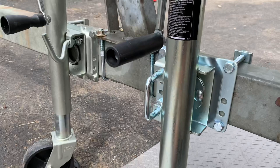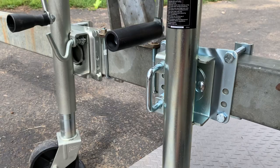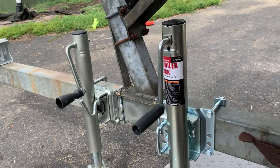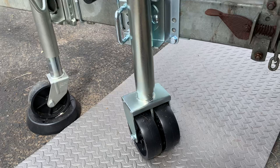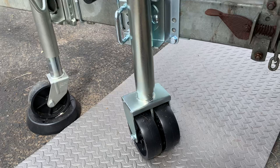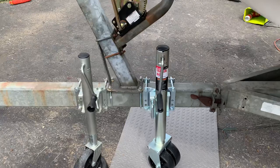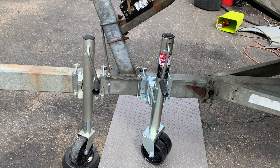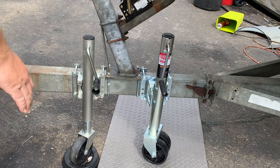So I would say with this heavier one you're getting thicker tube, a stronger tilt assembly, and two wheels. If the difference in price stays what it is — within $10 of each other — there's no reason I think I'll ever buy the lighter duty one again; this one's just nicer. The only downside is it will stick out further because you have two tires, and the C-clip on the lighter one is really the only other downside I can think of. If you're looking for a cheap but slightly stronger jack, you're not going to want to use either of these on an equipment trailer. These are made for boat trailers with maybe a couple hundred pounds of tongue weight — that's my opinion. Even though it's rated at 1,500 pounds, this is a pretty nice jack for the money compared to the lighter duty one.